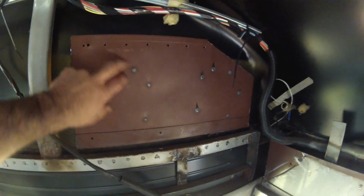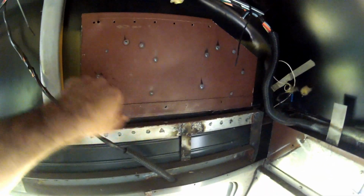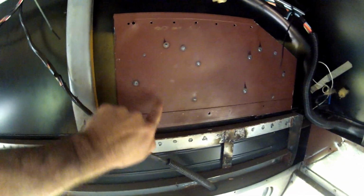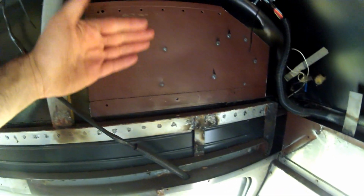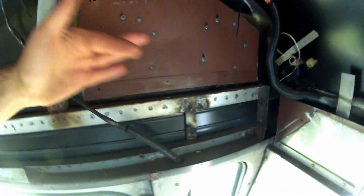I figure I could detail how I covered the emergency lights, the blinkers, for when the bus stops. I put sheet metal in front of the holes, the empty holes where the lights were. Spot welded them from the outside, like 10 or 12 spot welds. Ground those, sanded, and then bondoed the outside, and then primed over it. And that's how I did every single one of them.